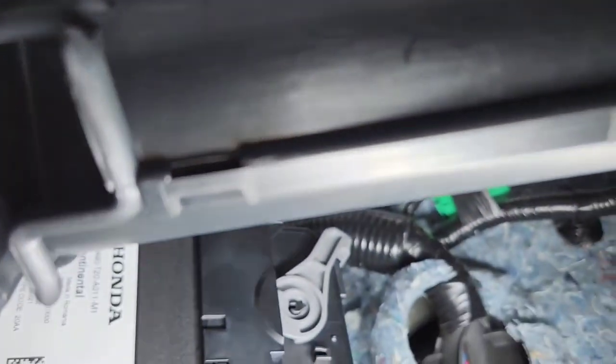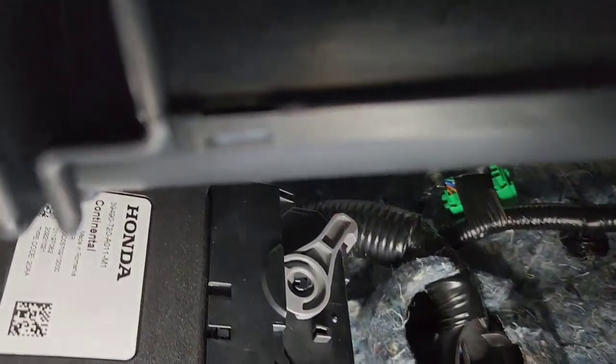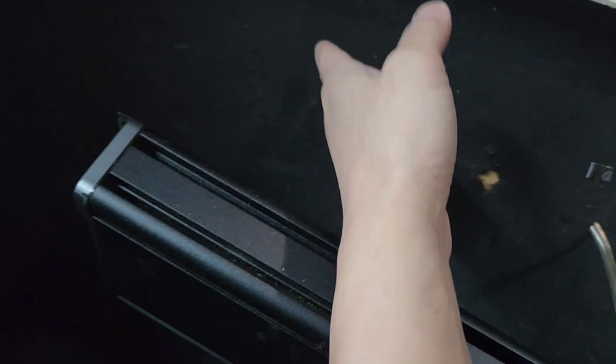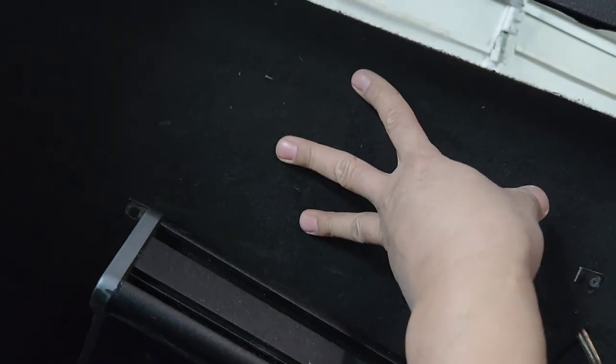For the power wire, you can run it right there. There's a big hole right here, so I'm going to fix that up and run the 0-gauge wire. This is a bigger box, and when the bass hits it can damage things because of the vibration — you can see the metal right there coming down. So I'm going to push this box back forward a little bit, put a bracket behind it so it won't move, and put the amp right here.